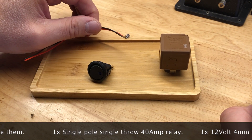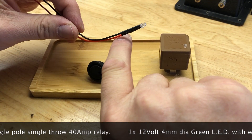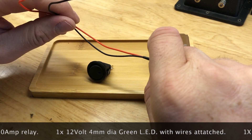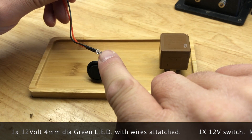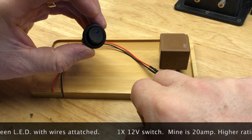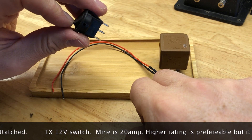We need a 12-volt LED. You can buy these with just the pins or with the tails on — it doesn't matter. Probably easier to buy with tails because you haven't got to solder it onto here directly; you can work with the flex. Mine is green and I think that's a good color code for what we're doing, but it doesn't really matter — smaller the better.